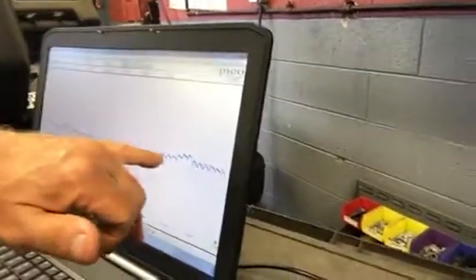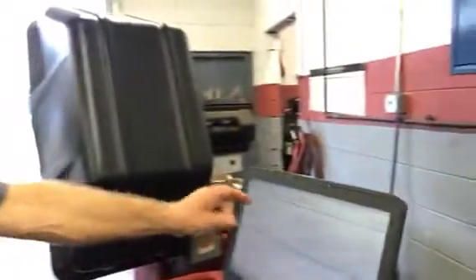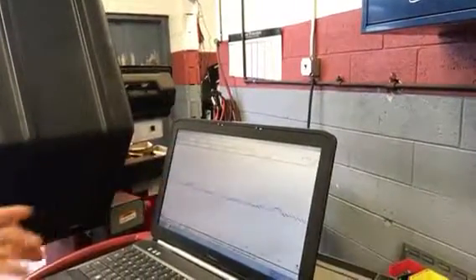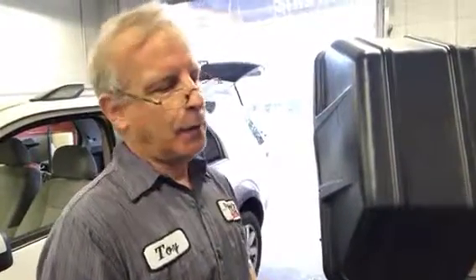This pattern doesn't look bad, but I'm kind of looking at this here — that's a little bit of a concern. So I'm basically letting it run; I want the fuel pump to get hot, and then maybe even shut it down, let it sit, and then start it back up. I can actually even calculate how fast the fuel pump is spinning — if I were to space out six to eight humps, I can calculate how many RPMs the fuel pump's doing. That'll tell me if it's dragging.